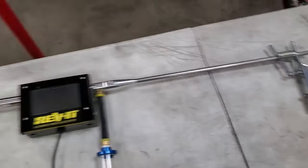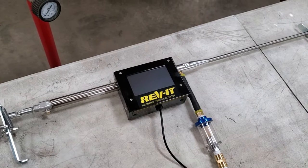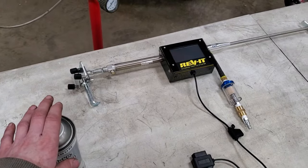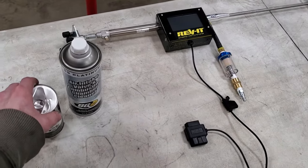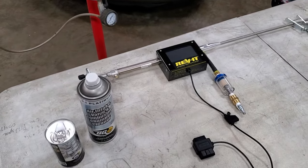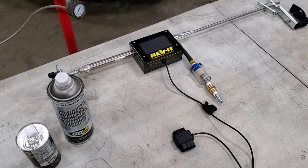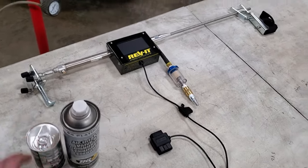This hooks up to the steering wheel and attaches to the gas pedal, and it's supposed to blip the throttle about once every 15 to 30 seconds to help prevent pooling in the intake. The other thing you don't want is if you're not revving the throttle — I've heard of shops having problems where technicians will do this service, walk away, and the cleaner will start running into the catalytic converter and cause catalytic converter damage. So make sure you're blipping the throttle consistently to prevent any of those problems.